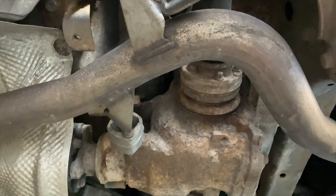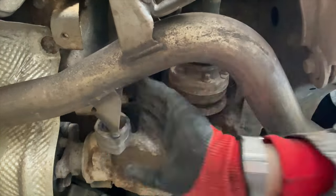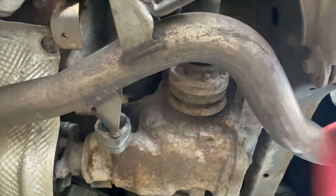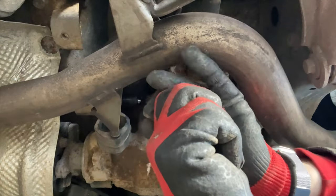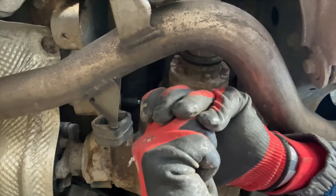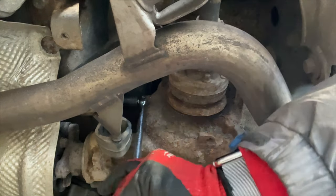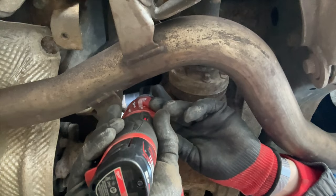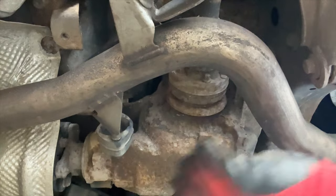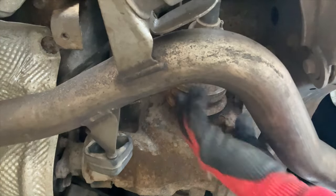That's one of them off. The one underneath — I'll have a go at the rubber first, just to see if it's going to come off as easy as that back one did. But it's really tight and I don't want to split it, so I'll just whip that bolt off — 18mm, up there on the side of the diff mount, which holds the bracket to the exhaust. I'll just take the bolt out and the bracket will drop down, and the exhaust with it. Just get a little bar on there and try and crack it off. We'll whizz that off. Get the ratchet on it as well. We should drop that bracket off now — drop that exhaust down a tad. That's giving us some room now to get this drive shaft out of there.